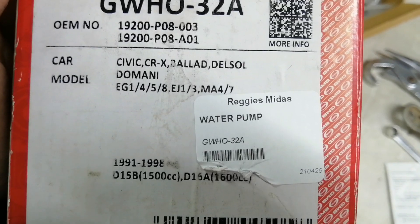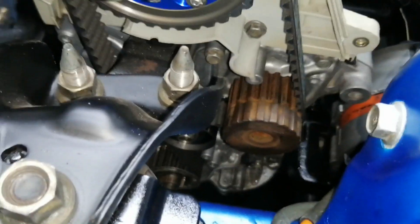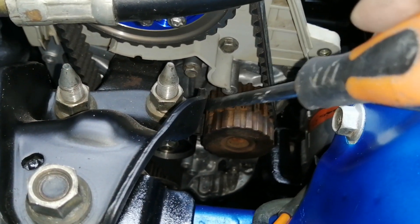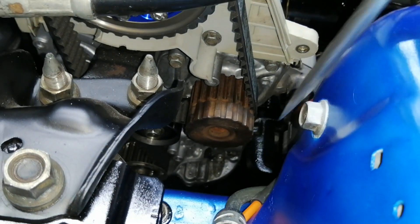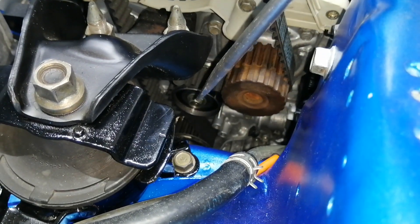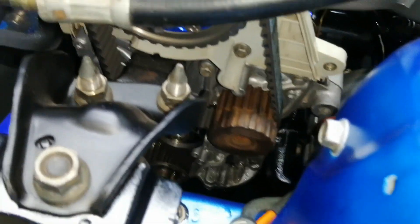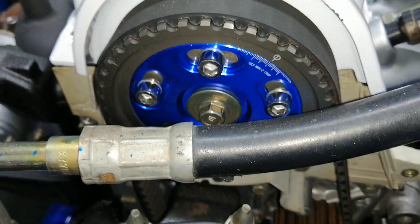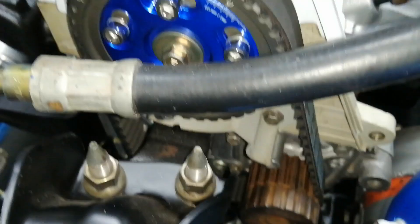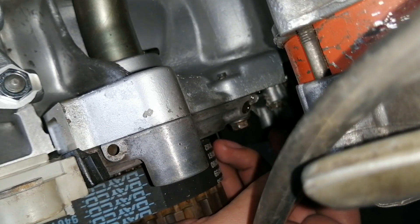They don't really list the Z or Y models because I think those have the other pump. So I'm hoping this one will work. It's fairly straightforward — you just unbolt it: there's a bolt over here, one down there, and another way down there, and one more under this pulley. You'll have to loosen the tensioner down there just to loosen the belt a bit. Important: do not mix up your timing marks. I'd recommend putting it at top dead center on the pulley and cam so you know where the belt should go. Luckily I confirmed it is leaking from the pump seal.